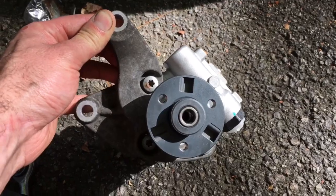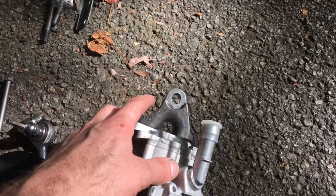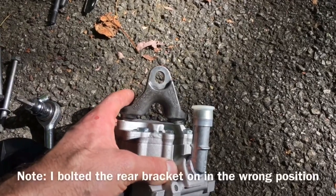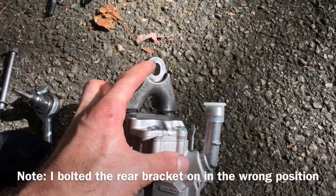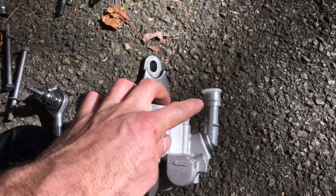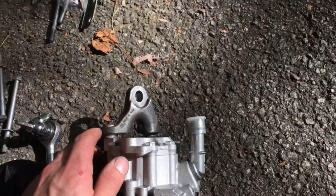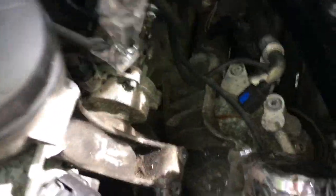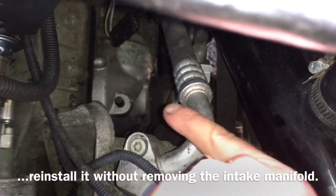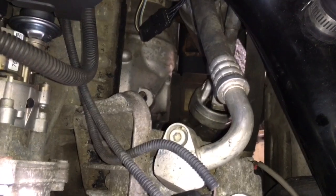You have three bolts that hold on the pump — two that are easy to access and you can see them on the front of the motor. Those are not even a problem at all. You may even be able to get them with the radiator fan on if you're willing to do that, but taking the fan off wasn't that hard. Then there's one bolt on the back side that you can't really see. Focus on getting the two front bolts off first, and then getting access to the last bolt. To get access to the last bolt, I removed the alternator, but I don't really think it was that necessary. You have to reach down here and the bolt bolts in sideways to the block, and they're all E12s that hold on the power steering pump.